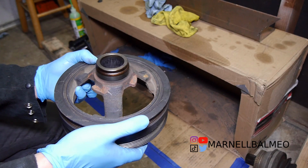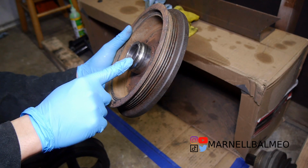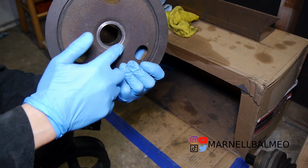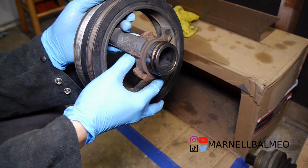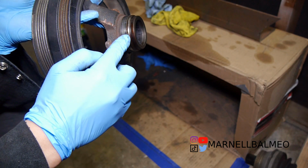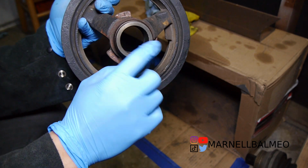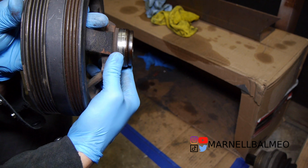Alright, so you're probably wondering, what am I talking about using this as a spacer? Well, in theory, if this is only 10 mm pushed in, because the crank is shorter, if I put a spacer up front, that should work. Now instead of making a new spacer altogether, I'm just going to go ahead and cut this off. And that's actually perfectly round, nice finish and everything. And that should work, right?